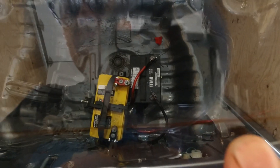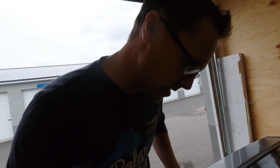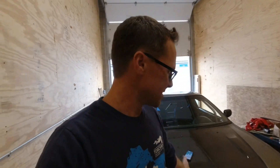Silver car is running awesome but the battery is bad. I bought a charger but it didn't charge the Optima battery, so I ended up getting a Titan tractor battery. For anybody wondering, a Home Depot $25 lawn tractor battery - a U1R1T - starts this thing. I just bought it because it was small. I'm going to leave the Optima on trickle charge for a really long time and see if that fixes it, because it's a brand new battery. The dead short in the starter probably killed it.